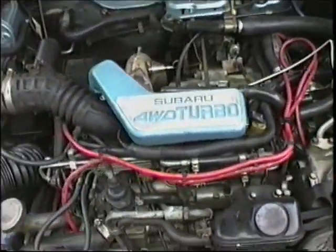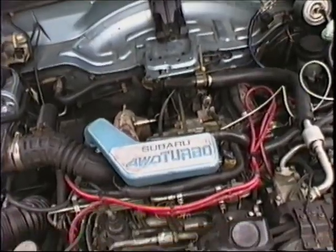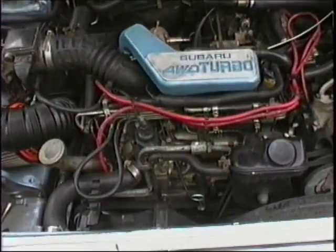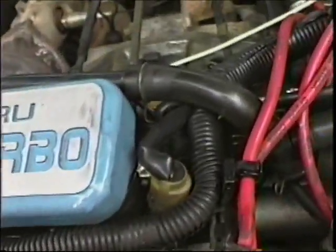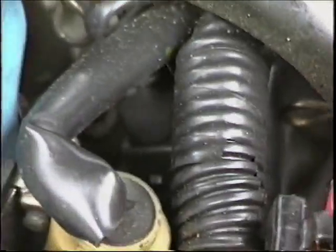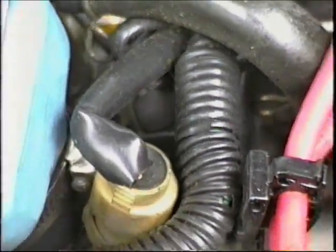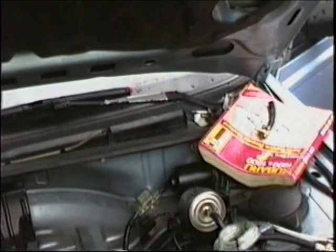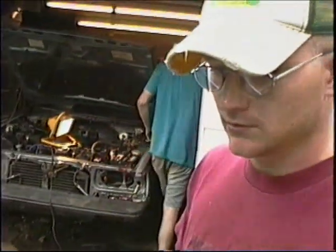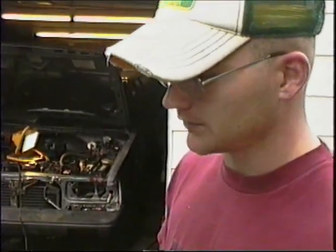Maybe it's your throttle position sensor. Yeah, it'll sputter, and sometimes it doesn't pick back up, but most of the time it does. Yeah, I can take it for a ride in it. I'd check out the throttle position sensor because the RX did that, kind of cut out. We took it apart and cleaned it up and clocked it a little bit, and it helped a considerable margin. It's not really throwing any ECM codes or nothing.